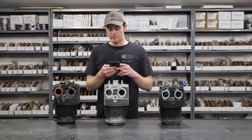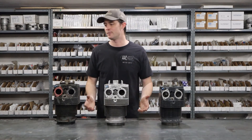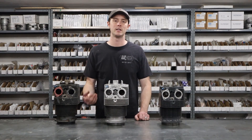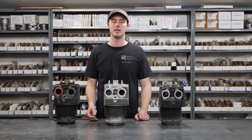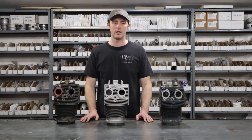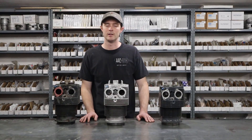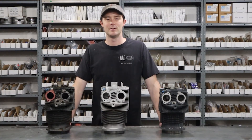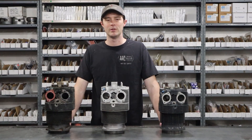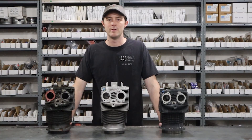Waypoint MRO asks: when doing an overhaul, what's the step-by-step process? That's kind of what this whole video was about, so definitely appreciate it if you watch the whole video. It's a long process — lots to do: cleaning the cylinder, inspecting it, making sure it's not cracked, repairing valve guides, seats, replacing valves as necessary, honing the bore, cleaning, painting again, and reassembling and installing the parts for a final time. Then it's ready to go out the door. If you could subscribe to this channel we'd really appreciate that — we'd love to show you guys more videos like this and continue to show you everything to do with these aircraft engines.